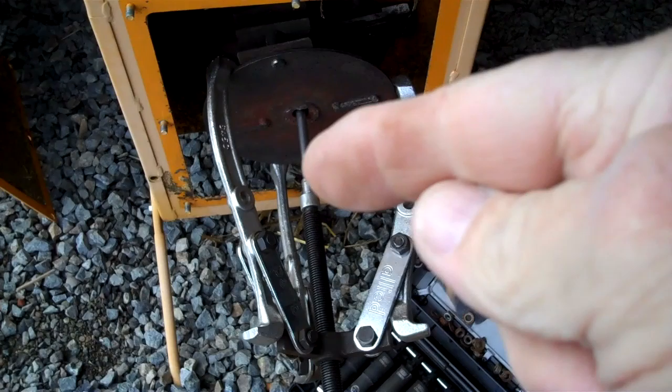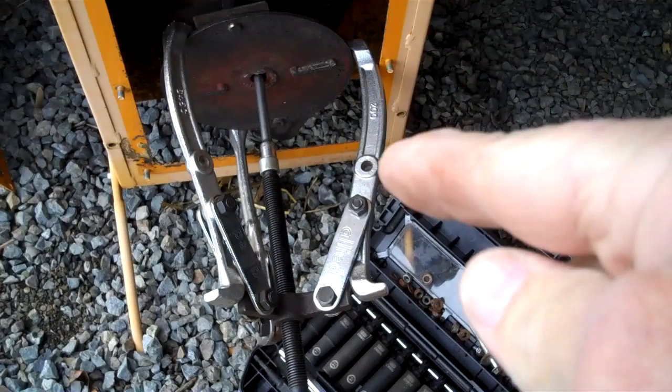This is a 12-millimeter bolt, and there were two of those in here, along with 10-millimeter bolts that go to the shaft. Get a gear puller — I had to jerry-rig a 3/8 socket extension on there to get my gear puller without having to reset my holes. Put the puller on there and just pull it straight out.